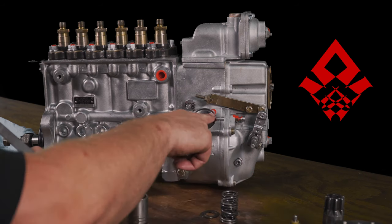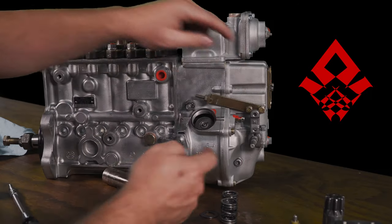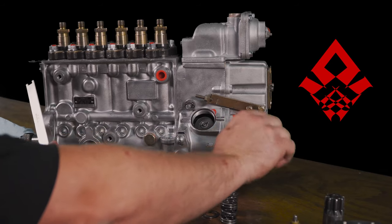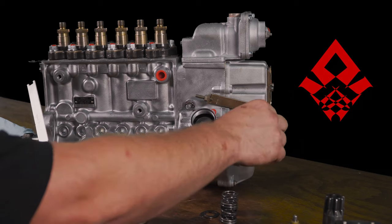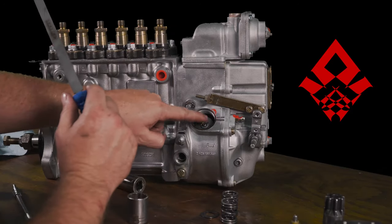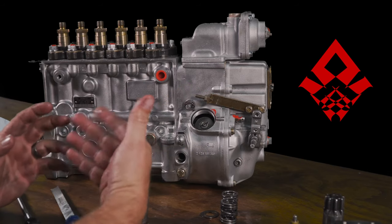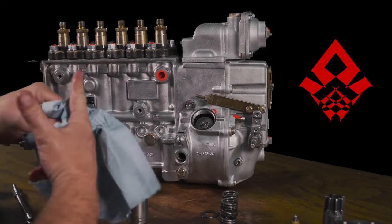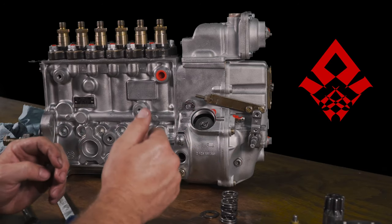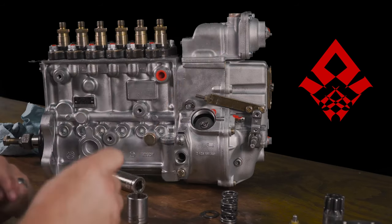I'd prefer the idle drops because you get a stronger idle. This is your idle set screw — a simple 10mm jam nut. You thread this nut up to raise the idle. The idle basically stops at the lowest point where the idle set screw is. It's easy to raise or lower the idle. I'd rather have less tension on here so you get a stronger idle. The only time I really want these tight is if I'm trying to get maximum RPM or build a really touchy throttle for a race truck. Honestly, I'd rather run a looser 5K governor spring if I wanted more RPM rather than tight 4Ks.